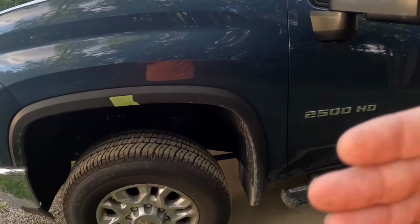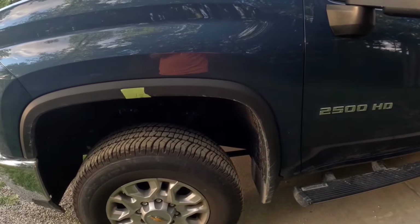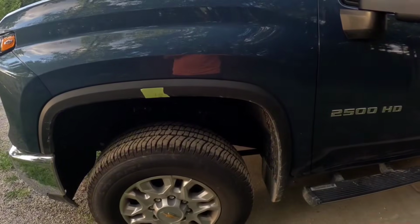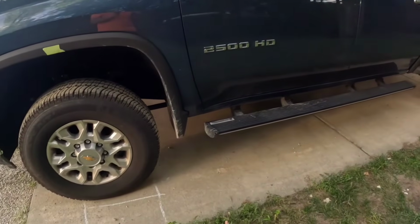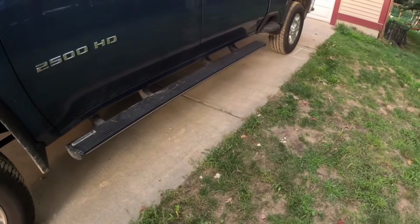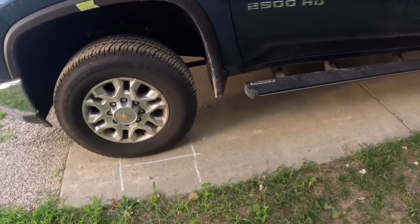So next I do is adjust the torsion bars from underneath and work my way up, and do it slowly, keep measuring it and checking it out. I do try to find as flat and level space as I can. This is actually a pretty close driveway, so not too upset.